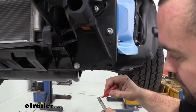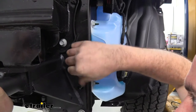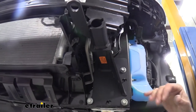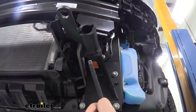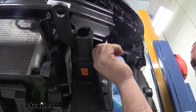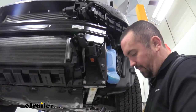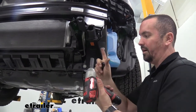Feed in the remaining bolts with Loctite applied. Don't fully tighten yet — you still need to get the tow hook bolt aligned up top. Tightening the top bolt first with an impact will cinch the base plate in and help the lower bolts thread up correctly. Apply Loctite to that bolt as well, snug everything down on both sides, then come back with a torque wrench to final-torque to the proper settings.